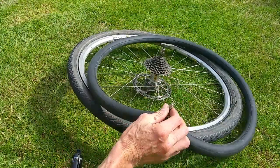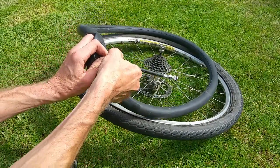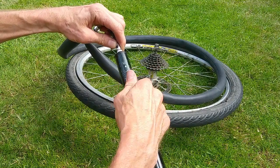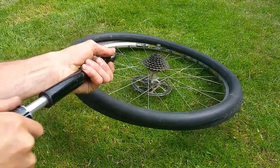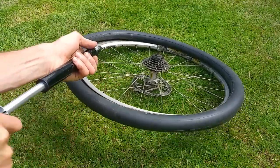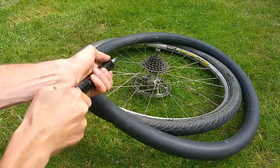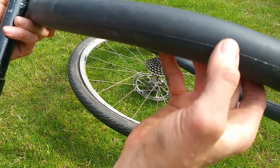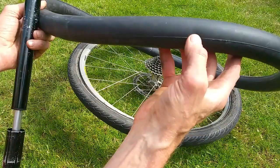I never bother with a water bath — I think it's too much hassle. I just make sure I'm somewhere quiet enough to hear the air escaping. Next to a busy main road that's half the problem: you can't hear where the hole is and end up just swapping the whole tube. It's a bit tricky today because it's so windy, but I can already hear it — I can even see it. Normally I just run the tube close to my ear and find the hole that way.